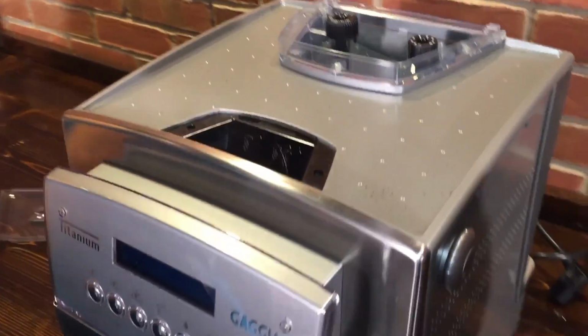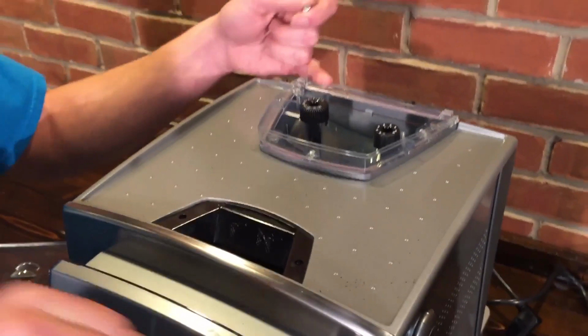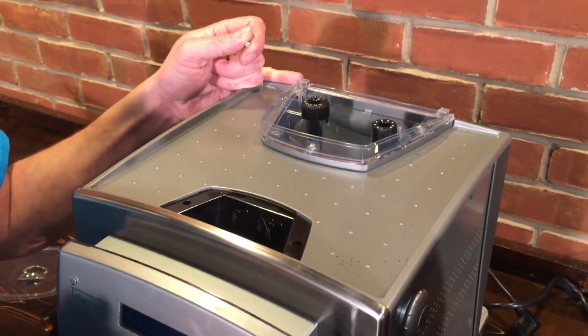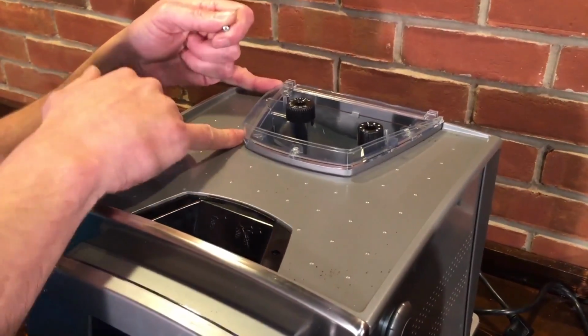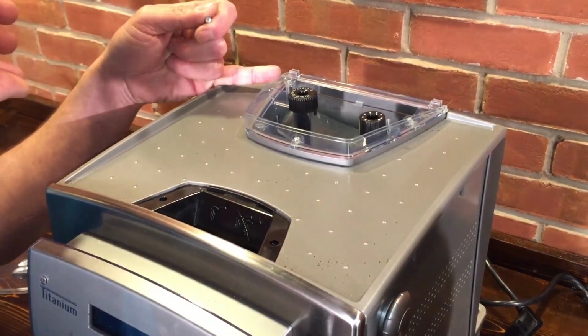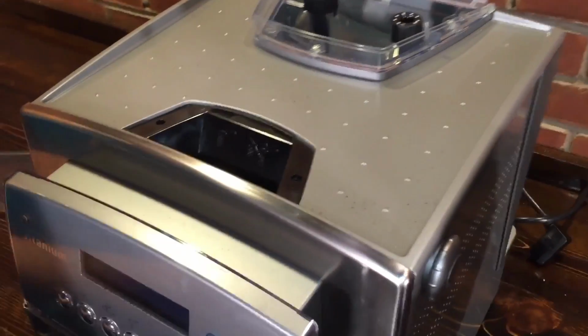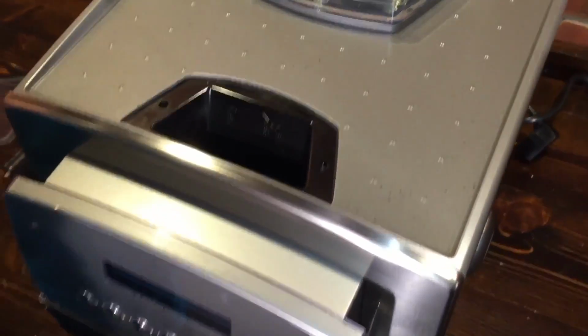The screws on the back panel are not a big issue. Sometimes you might even have to push it as you're screwing it to get it to go into the metal. These ones are more delicate. You've got to screw it until it stops, and once it stops, don't turn it in anymore because you'll ruin the hole. These two, it doesn't really matter. They're going into metal also.